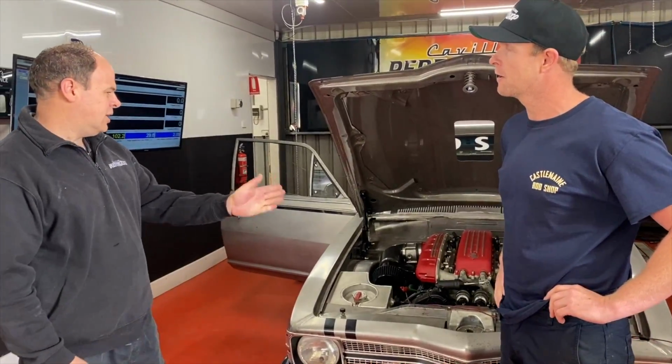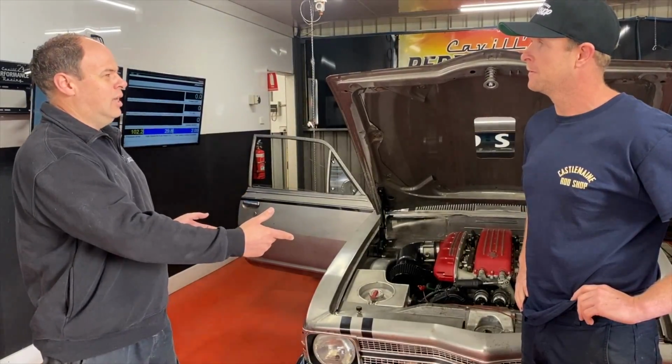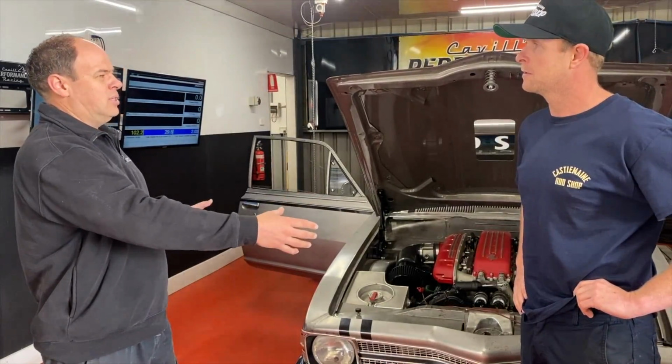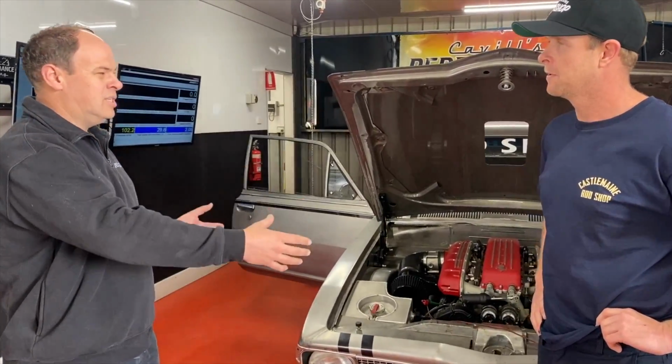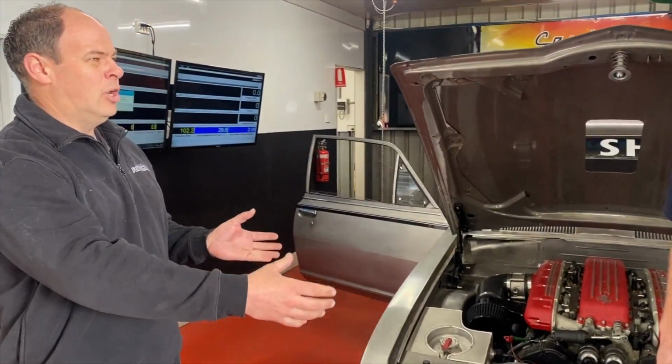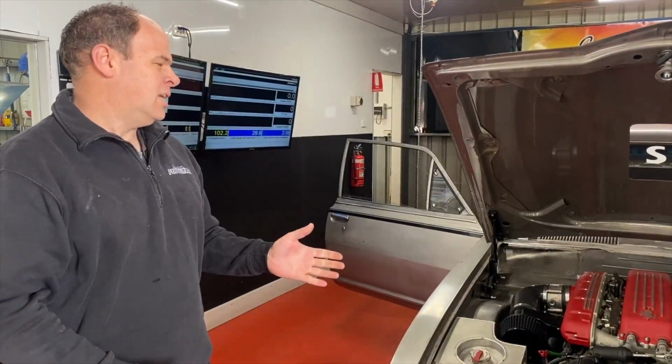No, basically Ferrari set these up as 2 separate 6 cylinders. So Ferrari have 2 crank sensors, and they run the 2 banks separately, sort of, and then the computer ties them together. So it's like having 2 6 cylinders running side by side. We're not running it like that. We've got the 1 crank sensor and it's running as 1 V12, but that's how Ferrari do it.